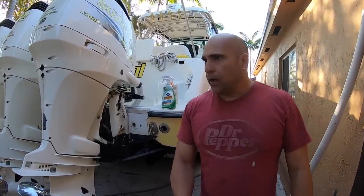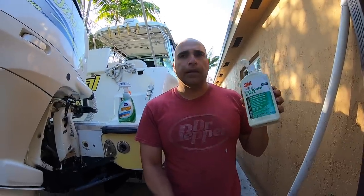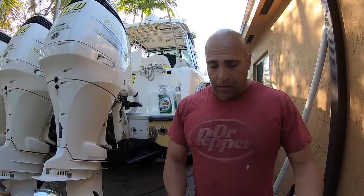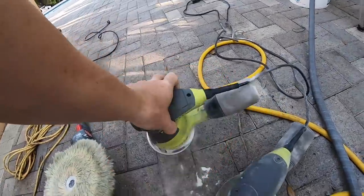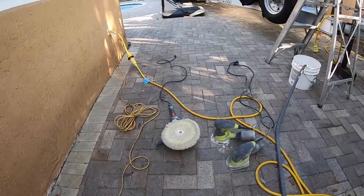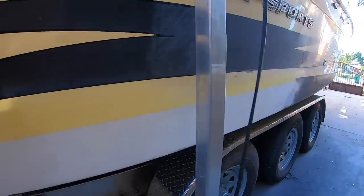After the 800 I'm doing rubbing compound — it's made for heavy oxidation, so it works like a very fine sandpaper to bring the shine and luster back. Then I'll finish with a high-gloss polish at the end. You don't need expensive tools. I'm using this sander here — tool-wise, that's probably about $40. So about $150 total plus sandpaper and rubbing compound. The trick is it's a lot of labor — you've got to sit there and grind away, but it's doable. You can do it yourself.